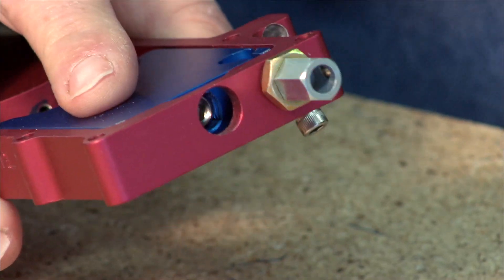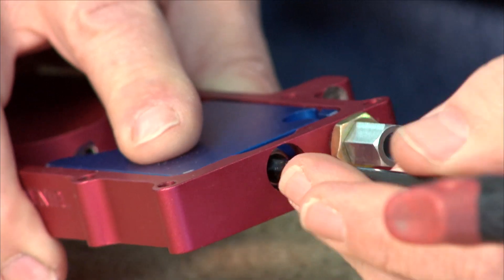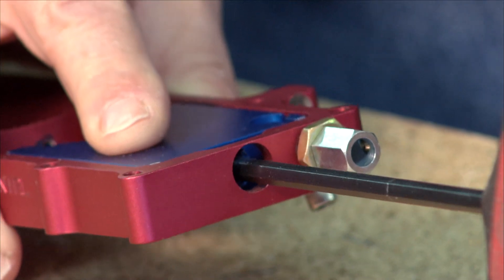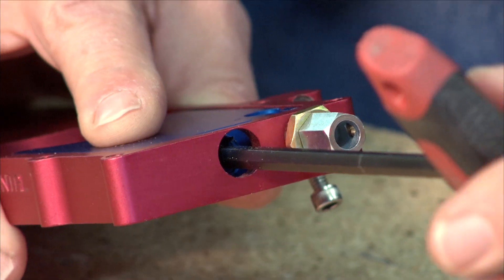If you get a huge EGT rise of several hundred degrees, the engine might not even run well — that indicates an excessively rich mixture and you'll need to lean it out. You lean or richen the mixture by virtue of a set screw in the throttle end. You'll use your hex key — simply an Allen wrench. There's a lock screw in here that you'll remove. There's your lock screw, which is a simple set screw, and then in here there is another hex key position that is your needle carrier. Clockwise will move the needle in, which is leaning the mixture. Counterclockwise moves the needle out, which is richening the mixture.